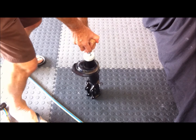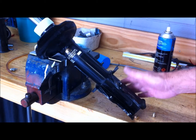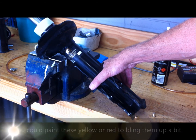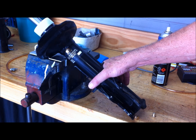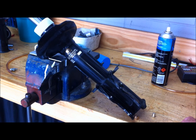That's finished and ready to go back in the vehicle. Pushing it up and down — it feels just as good as the new KYB I've installed, nice and smooth. That's the finished rebuilt strut. We're going to be installing these into my friend's 2007 W639 109 CDI Vito and will give some feedback on how they go. We'll probably do a follow-up video on how to change the fluid while it's still in the vehicle — since we've got a sump plug on the bottom and a filler up the top, we should be able to change the fluid in situ. Hope you've enjoyed this video, thanks for watching.